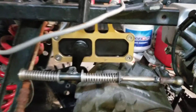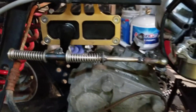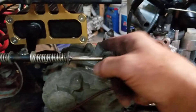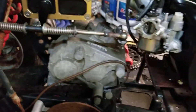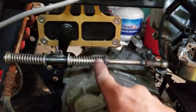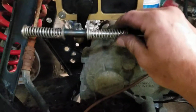The shifter is hooked to a servo and I made a buffer linkage so the servo never gets stalled out. Just because the shifter lever is moving doesn't mean it'll follow through, because there are cogs in there and sometimes it hits the gate before it actually pops into place. We need a little movement on the input shaft for that to happen, so I had to make sure the servo was never going to bind up. We have a spring here and it works really well.